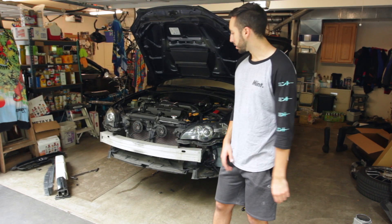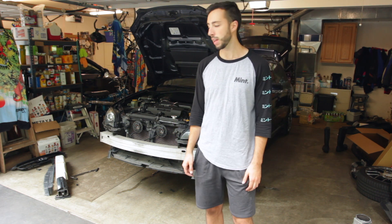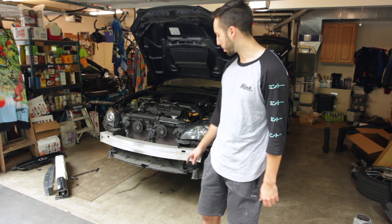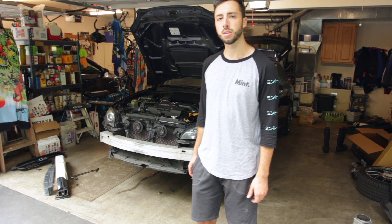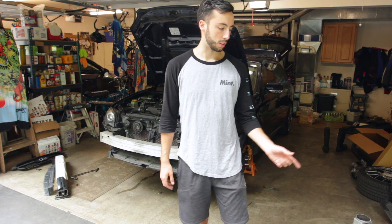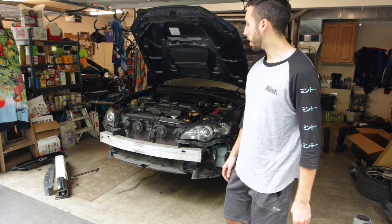With the bumper off the car, next up is getting the crash beam off. The JDM bumper has a slightly shorter profile than the US one, so it uses a slightly smaller profile crash beam to accommodate that. There are four bolts on each side to remove. You may have noticed disconnecting the fog lights when pulling the bumper — the JDM versus USDM fog light housing is a little different. There are ways to make the USDM ones work on the JDM bumper, but for convenience I went with the JDM fog lights and will swap the back cap on the housing to accommodate the HID bulbs.